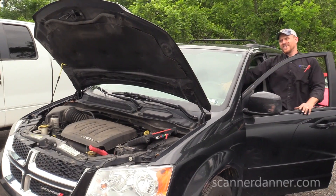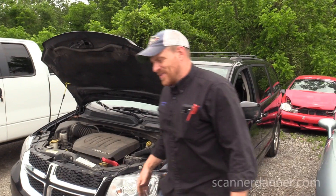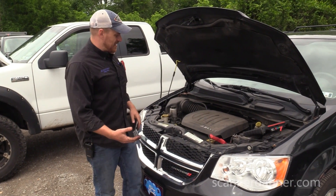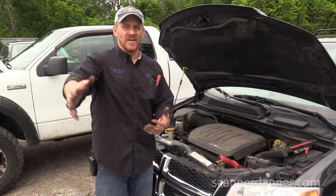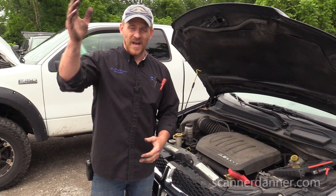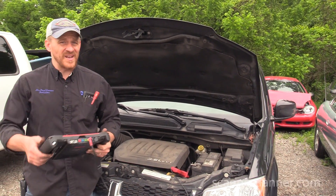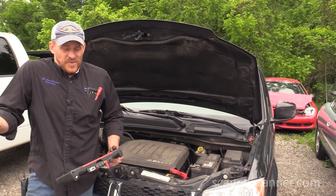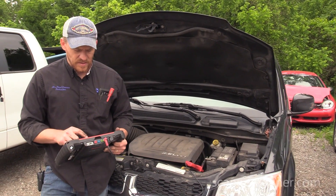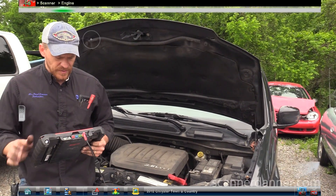To my son, that sound of cranking doesn't really mean much. To the trained ear, we're done already on this car. This has a compression problem, and I just need to tell Pete what cylinder it is and if it is, in fact, a mechanical problem, and then Pete will do the work. So I'm just going to read codes. Customer complaint is a misfire, and you heard the way it cranks. My suspicions are absolutely that this is a compression problem. I'd be surprised if it is not, and first we'll go to codes.